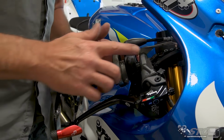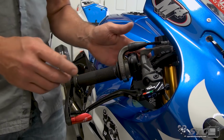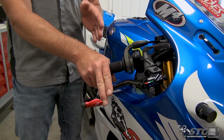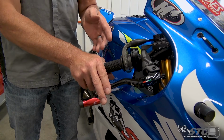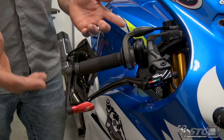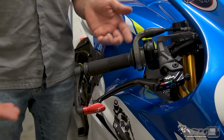If you want to slide it in closer to the clip-on cuff, so that you're grabbing more towards just the end of the lever, then you want to talk about ratio and leverage. The closer you can grab this lever to the end, the greater mechanical advantage you have, obviously, because you've increased the length of the lever.